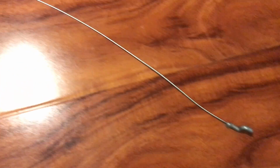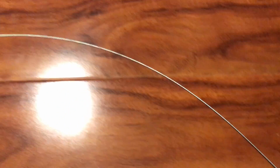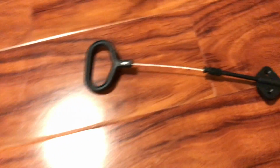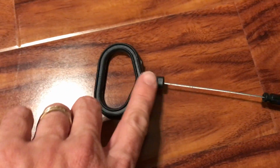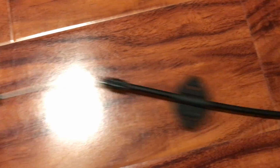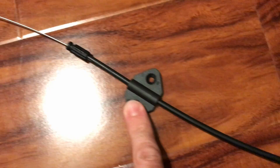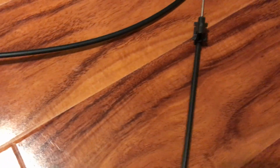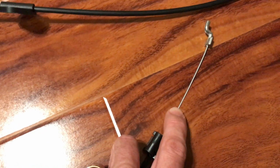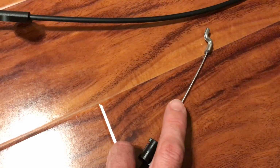So now with the cable out, get a measuring tape or a ruler and measure the length of that cable. In our case it's a 36-inch cable, and you're measuring the cable to where the handle used to be. So on a new cable, you're going to measure from the S hook on one end to this part of the cable, and you're going to find 36 inches. Also take note of what kind of mounts your cable housing used on your couch. And on this end, some have a return spring and some don't. So take note of that before you go down in the description below and order your part.